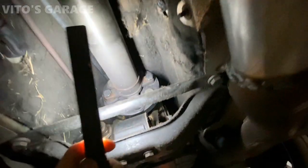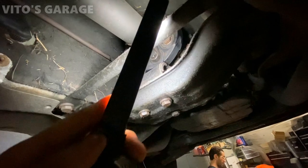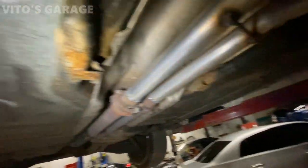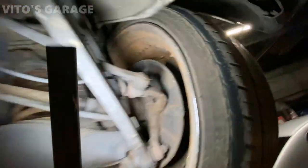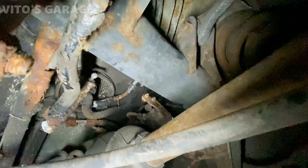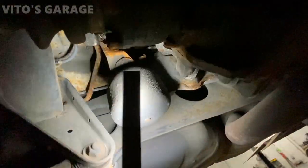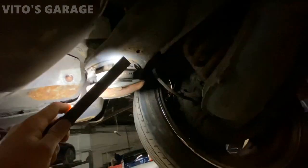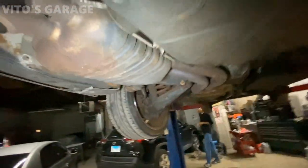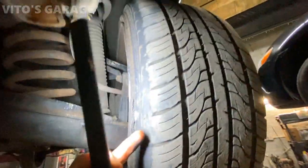This insulation is falling down and resting against the flex disc. The flex disc is bad — needs to be replaced, it's got cracking on it. Transmission mount probably needs to be done too — original. The SLS suspension doesn't work because that linkage from the SLS valve is broken — the car is riding hard in the back. The accumulators are probably bad and need to be replaced. Subframe bushings are bad too. And look at these tires — pretty bad, camber wear as well.